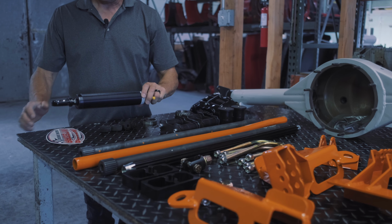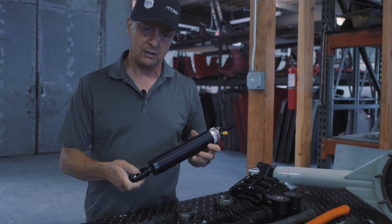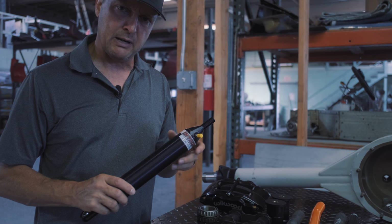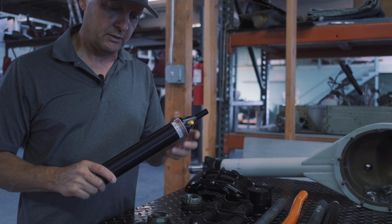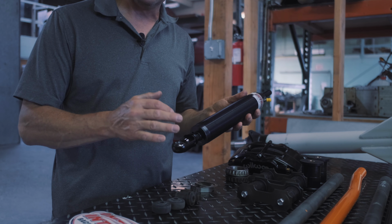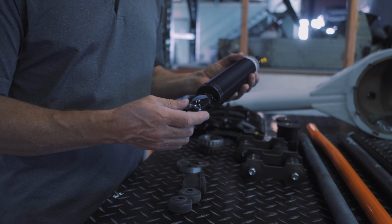I've got Integra shocks here. We've got adjustable single adjust, which I don't sell so often in our kit. One of the downsides is the upper mount here is a little bit difficult to mount into the floor, and we'll figure out a way to do that. And with the adjustment here, the shock is 1 inch longer, and when we're trying to keep the car low, we're going to run out of travel. But we're going to show you how we're going to work through this.